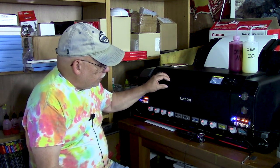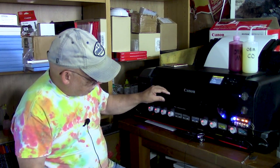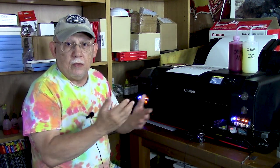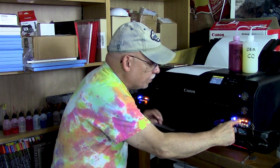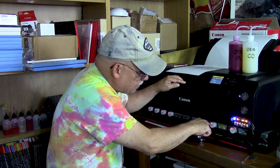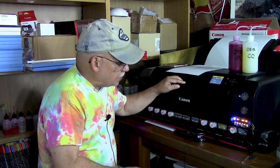Ultimately I will have all of them installed. The reason I don't at this point is because I'm still running single-use chips on some — I believe five of them — so I want to use those up before I install sensors I've already calibrated and proceed to print as if I had a full cartridge. Here's a nozzle check I just did. My gray cartridge has 25 ml of ink in it, and I calibrated the sensor to trigger around 20 ml, so we'll see how accurate this turns out to be.